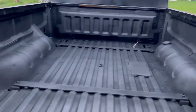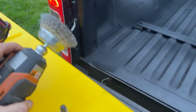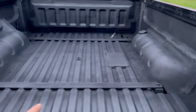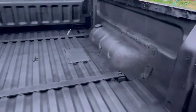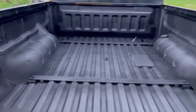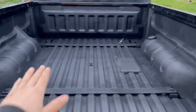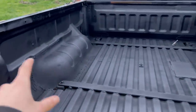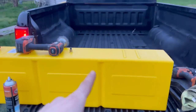I did end up getting the tank in and got it all working - you can see the little hose coming through there. I've now pulled it back out after having all the mounts in and given the whole inside of the tub a good hit with the wire wheel to get all the little bits of rust off, given it a good wipe and clean, then hit it with underbody rust coating - it's got a tar material in it, super thick, and obviously prevents rust. It's making it look a lot nicer and blended those tub wells in nicely. It's not perfect, but considering it's a Ranger tub on a Patrol, I reckon it looks pretty good. I've got a set of drawers going in tomorrow which will cover all that, and the fuel tank covers are back in. I'll probably make storage boxes around the wheel wells anyway so you'll only see the top half which is all still factory.